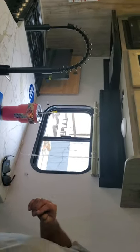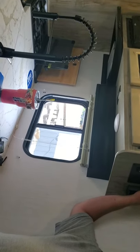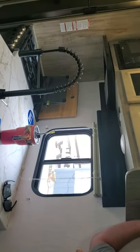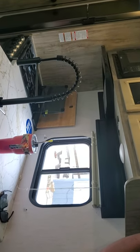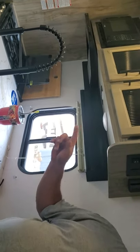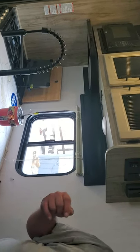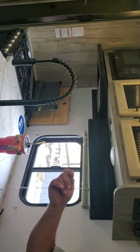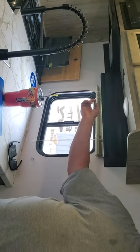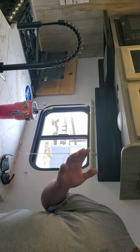This display shows the volts going to the battery. The camper has a solar panel on the roof, so it keeps the battery charged at all times even when it's sitting next to your house and not plugged in. However, if the refrigerator is left on overnight it will draw enough amperage to run the battery dead. If you don't want anything running, there's a battery disconnect in the front compartment on this side — shut that off and it kills everything inside.